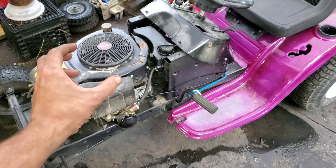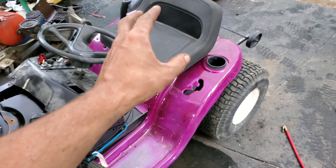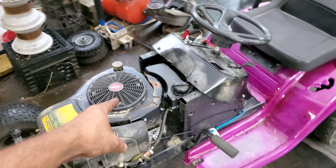Why did we add a gas pedal to the hydro? What we figured out with the giant pulley was that we cavitated the motor in the hydro just attempting to idle. Our theory, which we're going to try at the next race, is if you could dial it in at about 3600 RPM or so, do your launch, and then as the hydro gets moving give her some gas and really pump it for all it's worth. We'll see what happens. The hydro is not dead — it's actually doing really well. It's experimental, so updates are when we find more to experiment with.